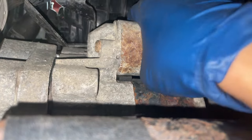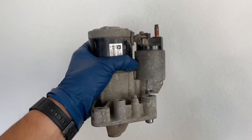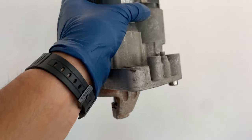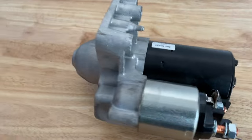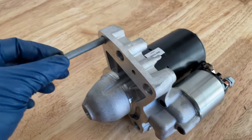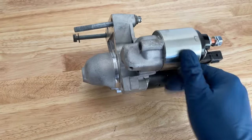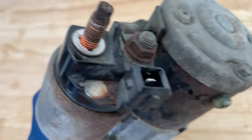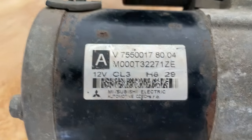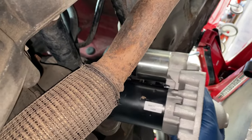After you remove that final bolt up there, the starter will start coming off. You just have to maneuver it out — it's like a puzzle, and the old starter pretty much comes out head first. You just have to move the exhaust a little bit and wiggle it around, twisting and turning as it comes out. Here's what the new starter looks like — here's where the 13mm bolt goes in, one of the E12s goes in here, and the other E12 goes down here. And this is the old starter — as you can see, it's corroded in the back. I transferred the old bolt guide over to the new starter, and this is how the new one will go in, right here to the right of the exhaust, twisting and turning.